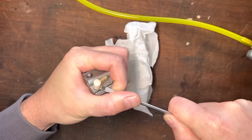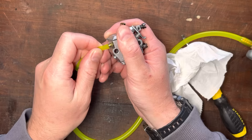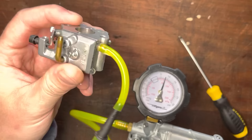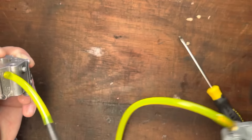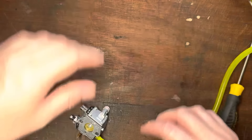The plastic ones can actually be popped off. That will leave you this little brass fitting. Let's test this independently and see if it's the brass fitting that's leaking — put a bit of soapy water on there. That's no longer bubbling and it's holding firm. So that is our culprit. We'll come back and test that one at the end just for interest.